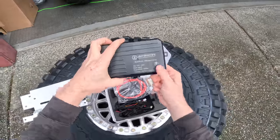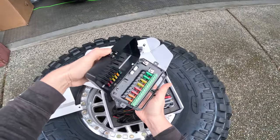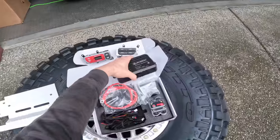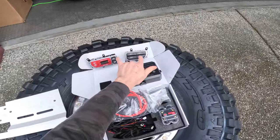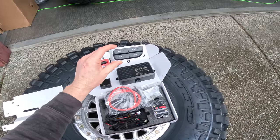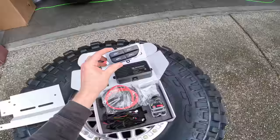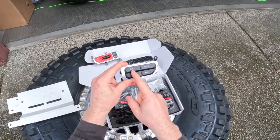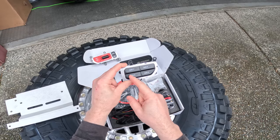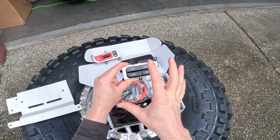What we have here is the Z Automotive switch assembly kit. This is their solid state control box where we can wire up to eight accessories, and we're going to be able to tie that into our OEM switches. We'll have four switches with very OEM-like functionality that we can control through the touch screen display in our Jeep. We can set these switches to be either constant on — remembering their state after we turn the vehicle on and off — or be momentary latch, so they just go on as we press them exactly like you would from the factory.